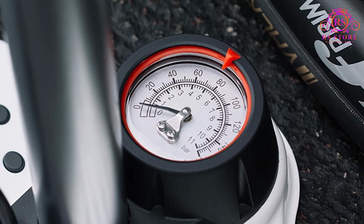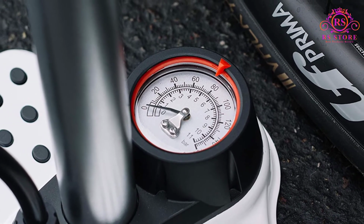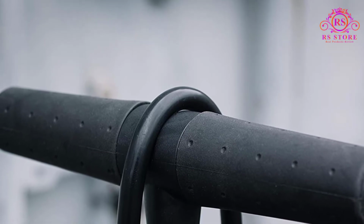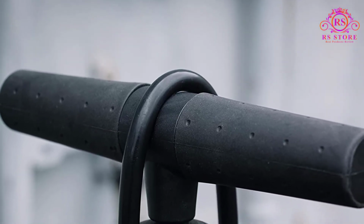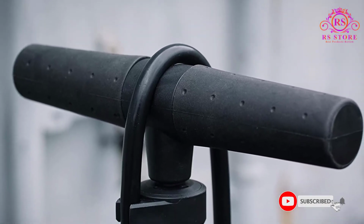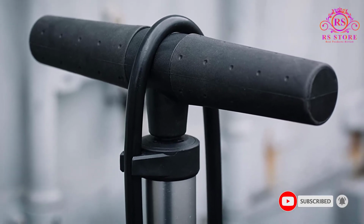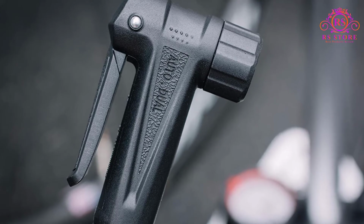A wide handle with rubber grips feels sturdy in your hands, and the industrial-grade pressure gauge is rated to within 2% accuracy. This pump has been knocking around our office for 18 months, and it just won't die. The gauge isn't perfectly accurate, but it's consistent. It's most off the mark at the low end of the gauge. At 45 psi the pump was registering only 40 psi. But it gave more accurate readings at higher pressures.